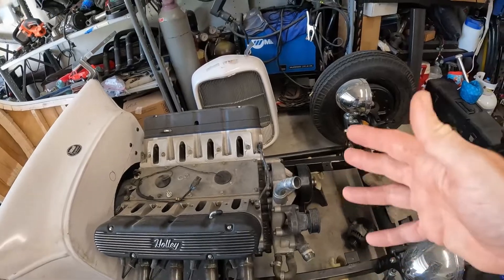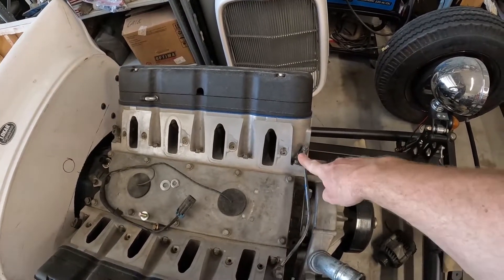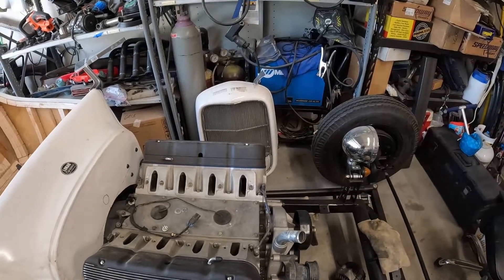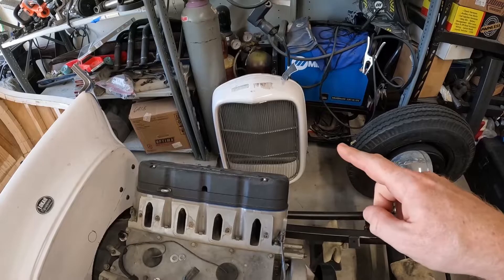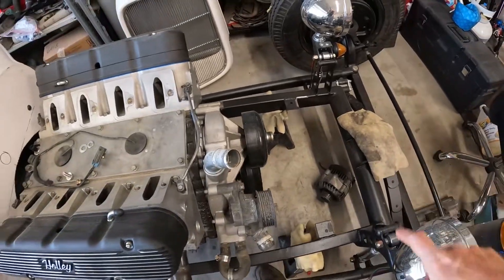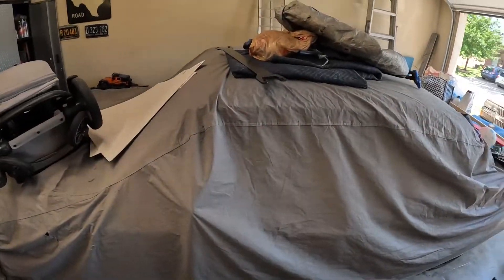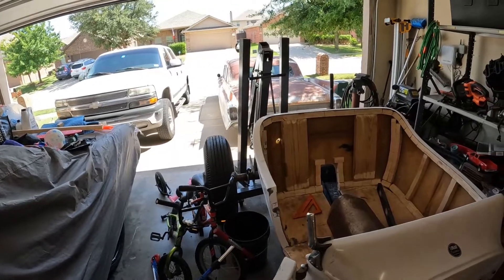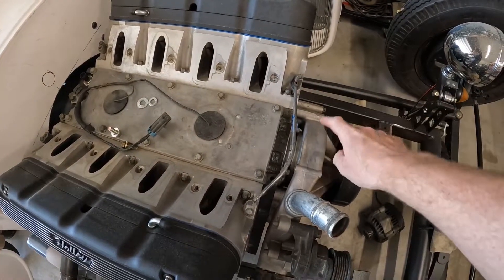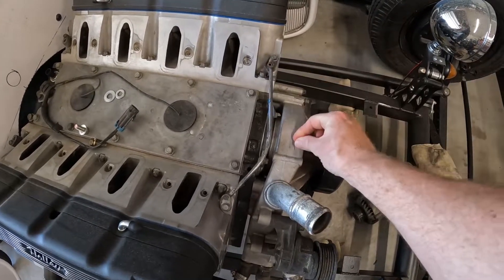Lastly, and this is a bit of controversy — once you have everything hooked up, whether you tap back into the water pump or it needs to go into the radiator. This radiator over here, I actually have a bung in it, so I'm going to just run a hose right off this into the radiator. That's how the factory does it — like my truck, for example, it's plumbed that way. The Chevelle, it's all aftermarket but that's how it's plumbed. The Cadillac, however, somebody just tapped and put a fitting in the top of the water pump right there, so the hose just goes right there.